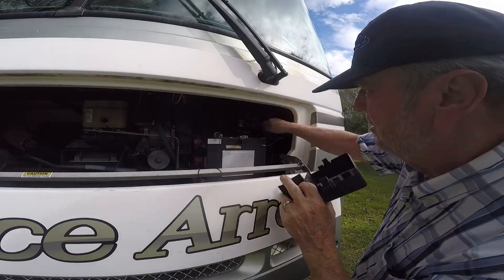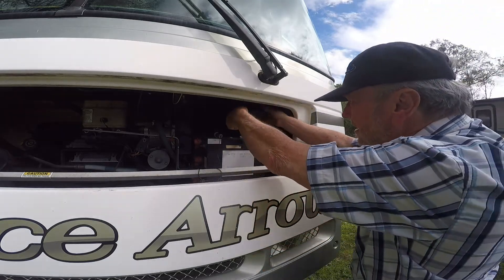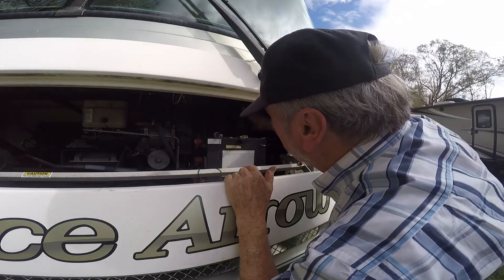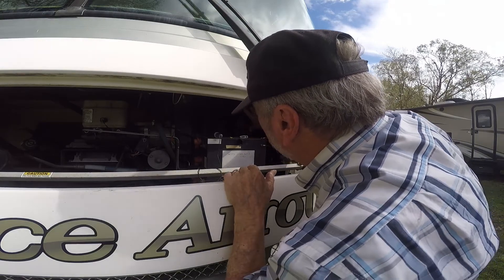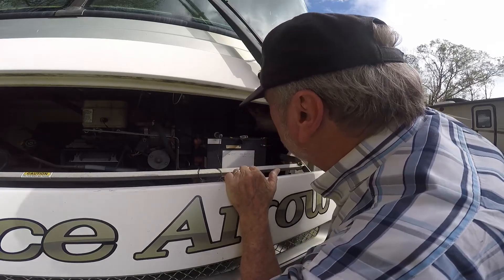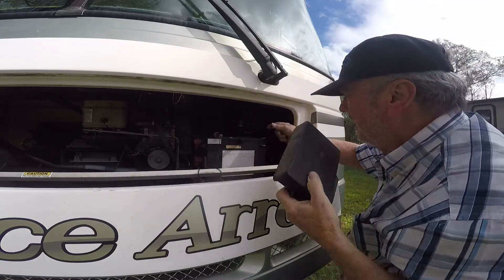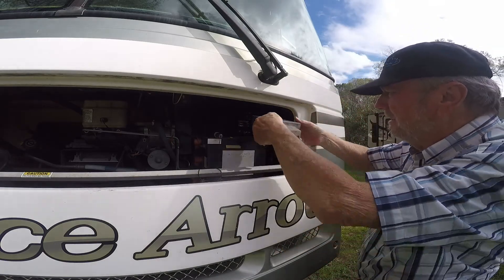This is the way it goes — there are some terminals down here that this little bottom part fits over. So you carefully line it back up and you want to get this on good because there are sealers in there to keep water from getting in. Push it in place until it snaps and then it should be locked in. I'll put my fuse puller right back in its little place here in case I need to pull one out again.